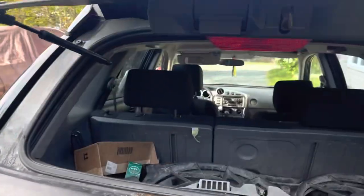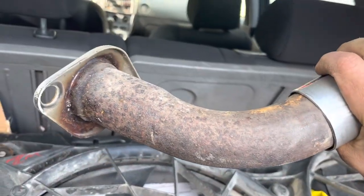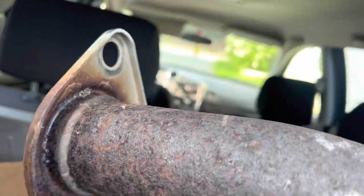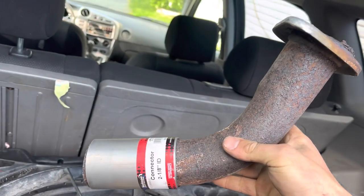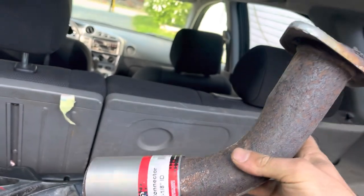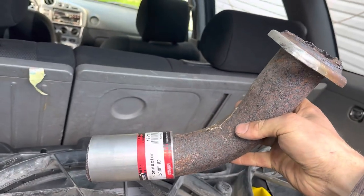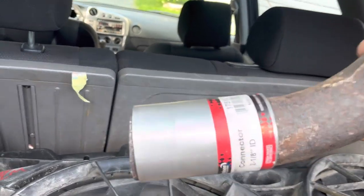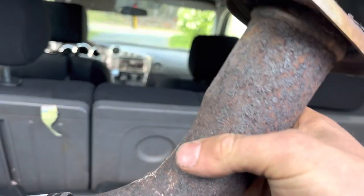Here's what we're going to do. We're going to fix this by cutting right here. The first thing you're going to do is find one that hopefully is not rusted off yet like this one. We can probably get the life of the car out of this — another 50,000 or 60,000 miles, I imagine. And you're going to cut that off right before it starts not being round anymore. Then you're going to get a two and one-eighth inside diameter connector, and we're basically going to make a sleeve. So that's the flange.